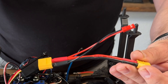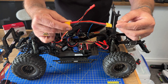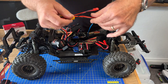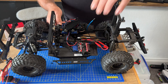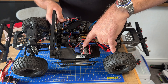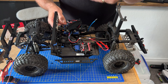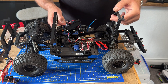So I have an XT60 from Amazon that's already got the JST plug pigtail built in, which means I can connect the motor to that and the battery to that, and then this power supply will continue the circuit for the lights. Also, the motor sensor cable will not be used anymore, because as long as you've got the max link cable connected into the receiver, the light module should know when the car's going forwards and in reverse for the brake lights and reverse lights.